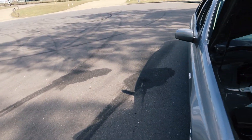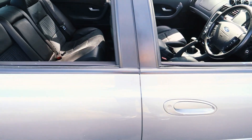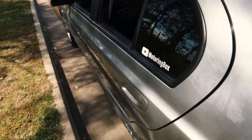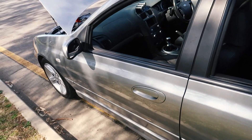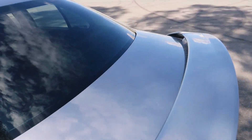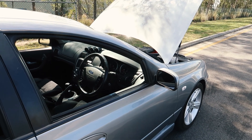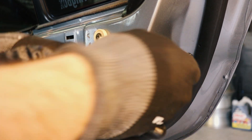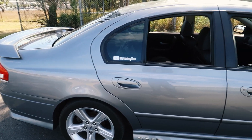From there, you should do all your typical checks. Check that all of the door locks work — lock the doors and make sure that none of them open if you pull the handle, because actuators on these cars are a really big deal. Pull all of the handles and make sure none of the doors open. If they do open, the actuator needs to be replaced. It is a security problem because you can't lock the car. Also, sometimes the actuators can prevent the car from realizing the door is shut. So you'll shut the doors, start driving, and it'll give you a warning saying one of your doors is still open. That's a sign the actuator in a particular door is cooked.